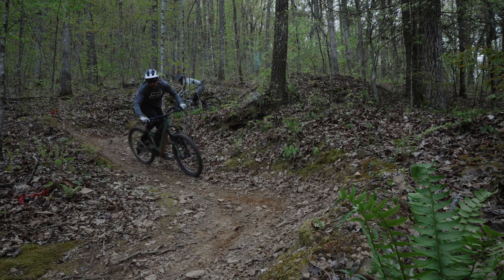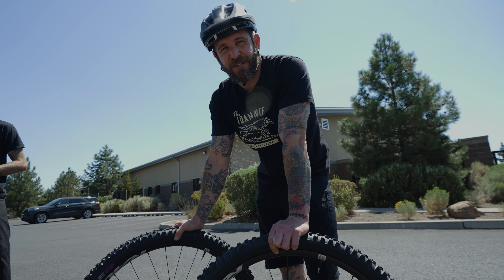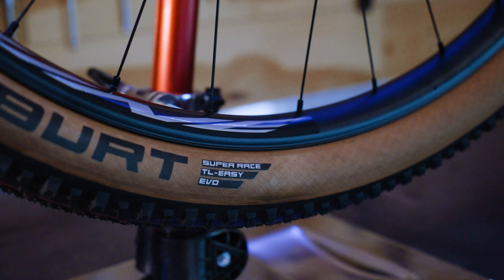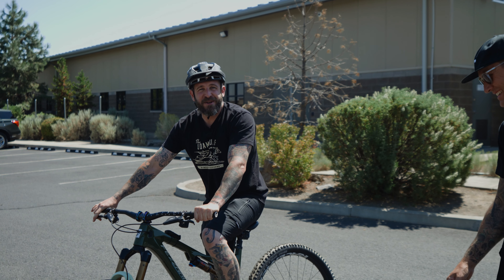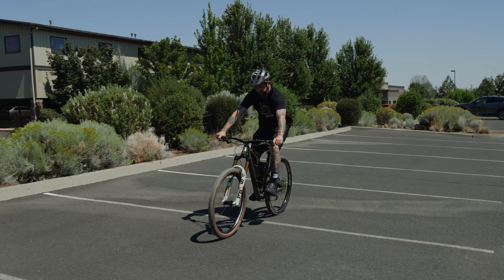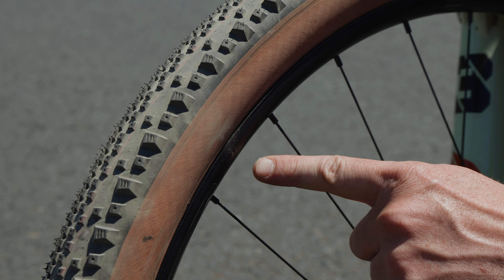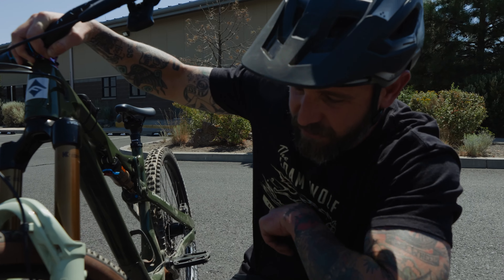Two things to note: first off, 22 PSI was too much — we didn't get the dynamics I was hoping for, so we went down to 20 PSI. Round one — hitting with the Super Race casing. We heard rim strike. I could feel the tire just come in and then roll over. You can almost see the line where the tire folded — clean here and dirty there. You can see when the tire folded and hit the rim, it actually pushed dirt down onto the rim.